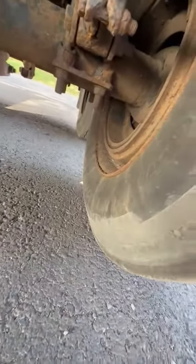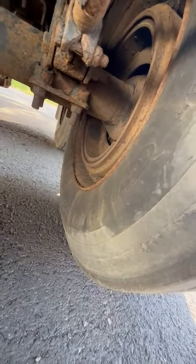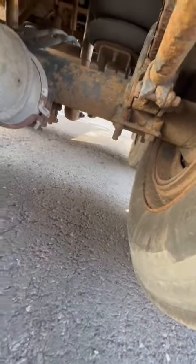If you look at the brakes themselves, they look on the lower end, especially this one here — you see how they look on the lower end? The brake shoes. Oh, that one's real low. Yeah, so these self-adjust. When the brakes get low, they'll automatically adjust.